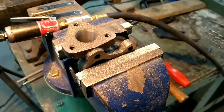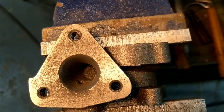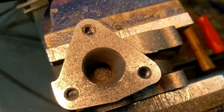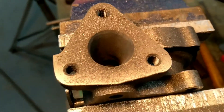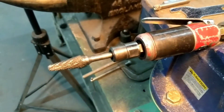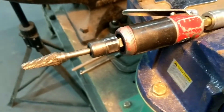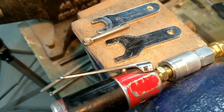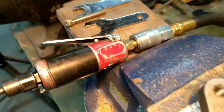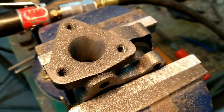I've ground on this for a while. Here's the inlet — it's getting better. I need to blend the wastegate hole in a bit, but it's mostly out to its size. I use a tapered bit — it's pretty good for most of that. The ball bit is reasonable for inside the snail housing. I'll flip it over and show the inside in a minute.